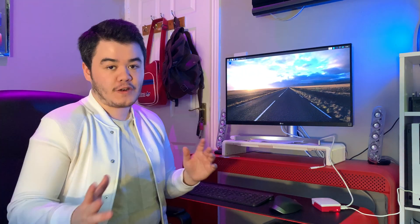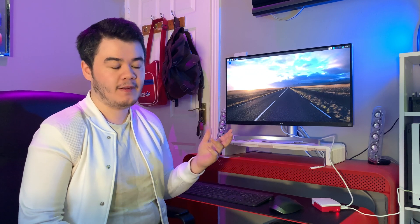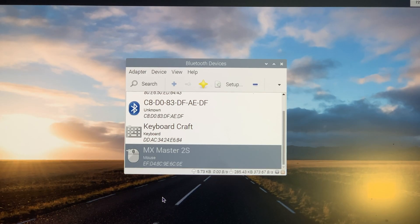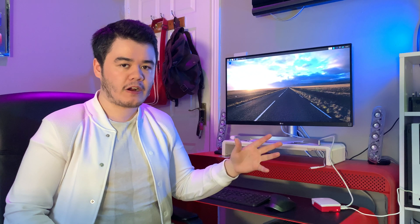I've been testing the Raspberry Pi 4 for a few days now and my first impressions as a desktop computer are a mixed bag. On the good news side, I kitted it out with a Bluetooth mouse and keyboard. It was a little tricky to set up — not because of the hardware, but because the Bluetooth manager built into Raspbian OS was being difficult. Using the terminal, I downloaded Blueman and that worked much better than the built-in Bluetooth manager.